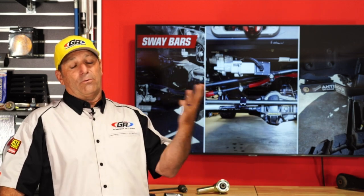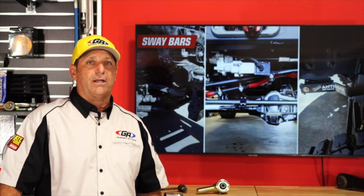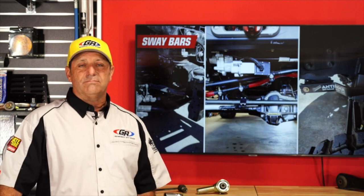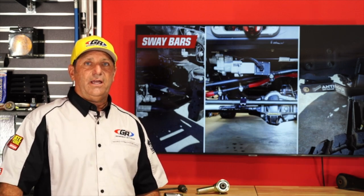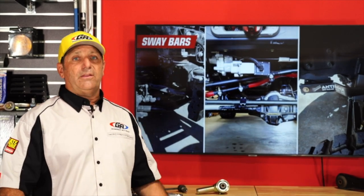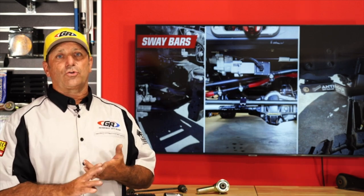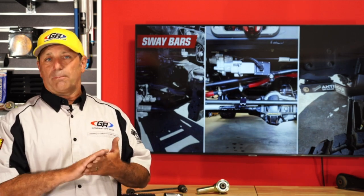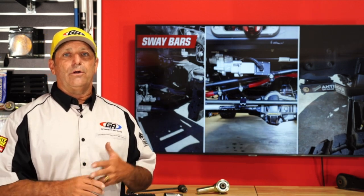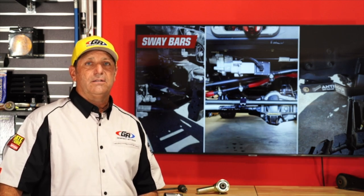People just can't believe how nice the Jeep feels — no bottom out, not getting beat up, just a much smoother ride. That's thanks to time spent with King and Fox tuning the shocks and getting the spring rates right, plus the low center of gravity and the flat belly that keeps the whole vehicle lower while still having tons of ground clearance. I do about six to eight events a year all over the country. Kelly's Tracer and Jamie's Growler are typically there — multiple vehicles you can get a ride in.